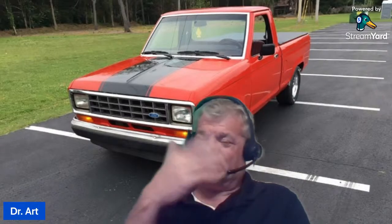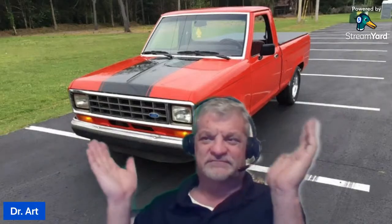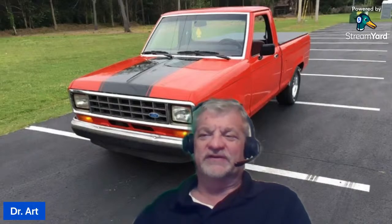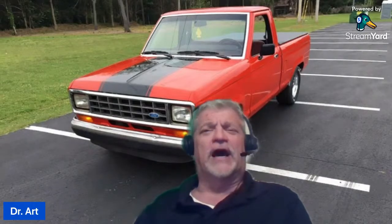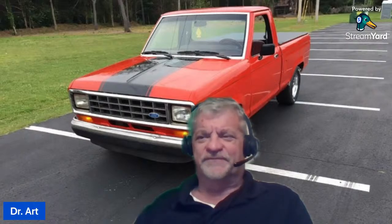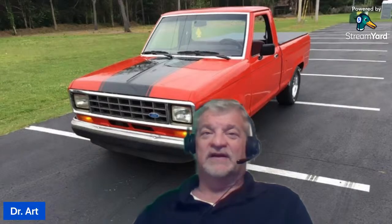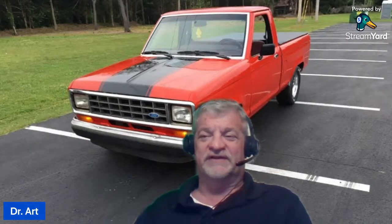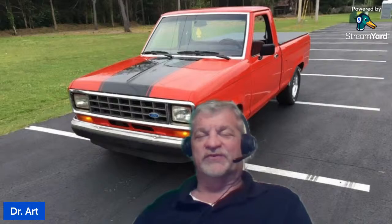Yes, it's important, but is it really that important? No, because it's only going to get a couple thousand miles on that motor. It'll be a nice motor. It's tight. The rings, it's not going to see boost. It's not going to see anything. So I made the ring gap pretty tight. The spec is like 12 to 16. They're all about 15 top and bottom ring.